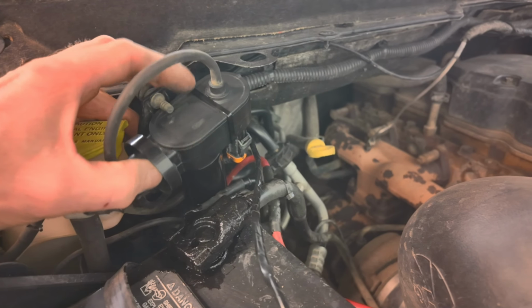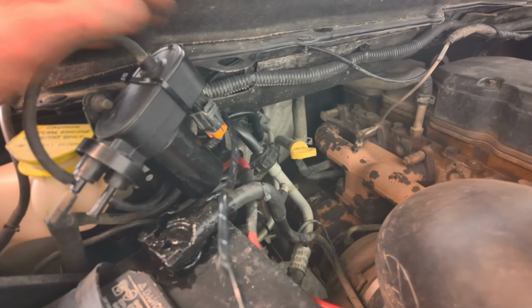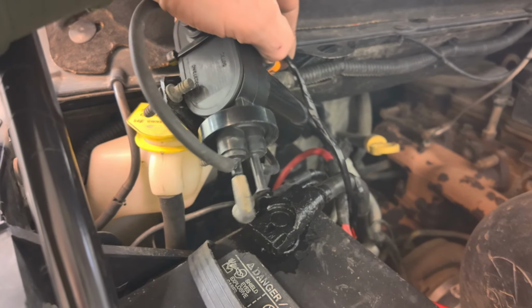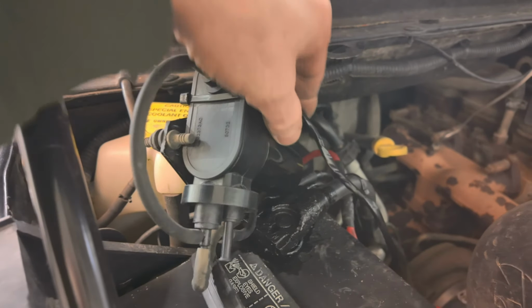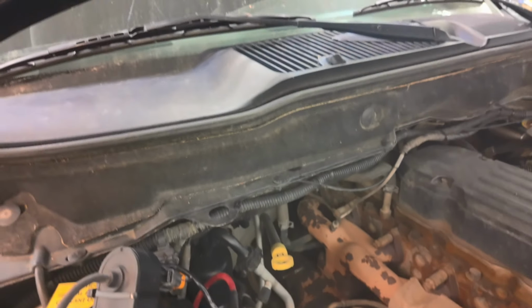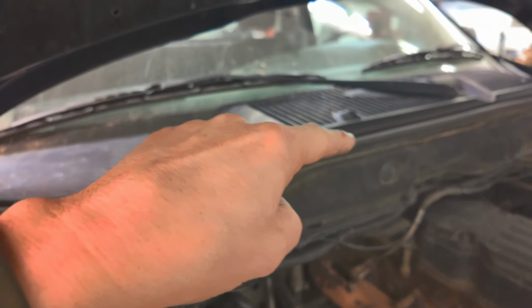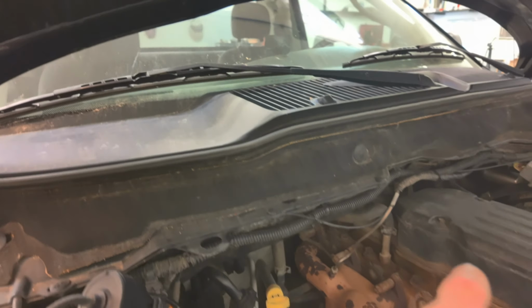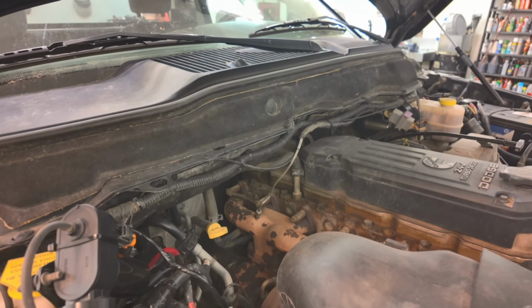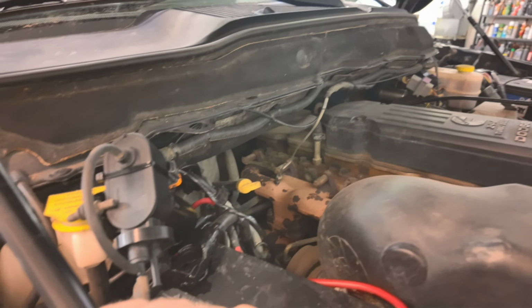Okay, so I just took the pump and plugged it into the harness and hooked up the vacuum hose on the bottom there, which goes along the firewall there. There's also an accumulator underneath the wipers right in here, and then the only other place it really goes is along the firewall and down to the cruise actuator, which is under the second battery on the other side.